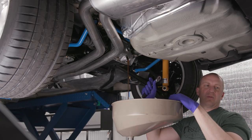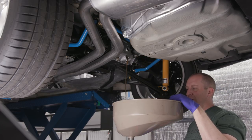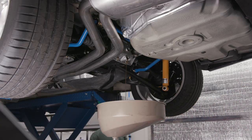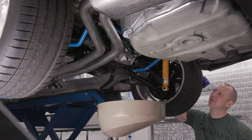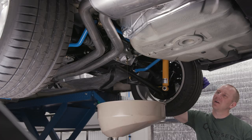See how tight it is up here — there's not a lot of room. Those hex bits have a long post and a half-inch ratchet won't fit either, and of course I don't have a 14mm Allen key set. So that little fancy kit turned out to be nice. The diff fluid looks pretty golden and beautiful — I don't know if these bolts have ever come off, but I suspect it's been changed at some point. The transmission bolts still had yellow factory paint on them.